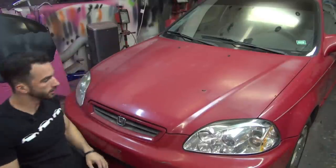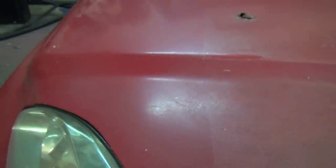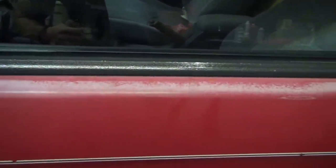Not saying that this is gonna happen in every scenario — this is just one scenario. We wanted to see what would happen if you left Plasti Dip on for a while and peeled it off on this particular car in this particular condition, and this is what happened. So let me show you the rest of the car. You can see the hood is actually very faded, very scratched — it's in terrible condition. That line I showed you is where we had four coats of Plasti Dip on the car, left it on for four to four and a half months, then peeled it off. The paint is still there and still intact, but it kind of lifted a lot of that powdery residue left over from the clear coat. We've also got a nice big rust hole right there, some areas that were attempted to be touched up with touch-up paint, front bumper chipping, and paint near the doors and window trim is completely gone.